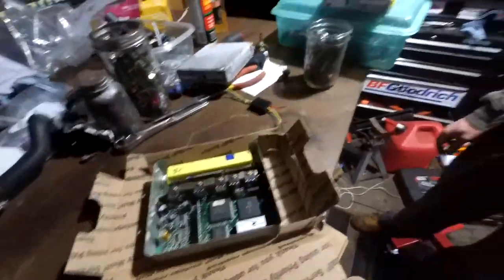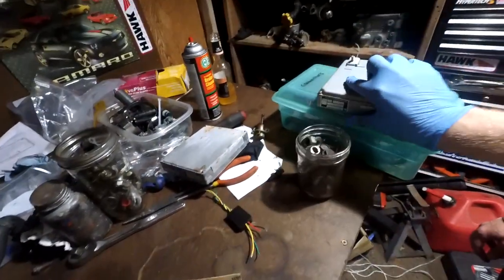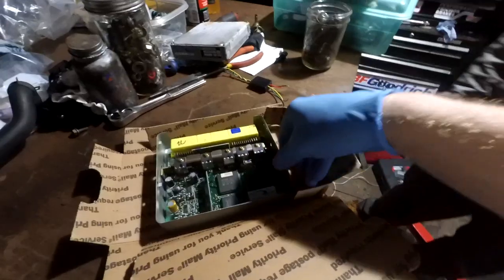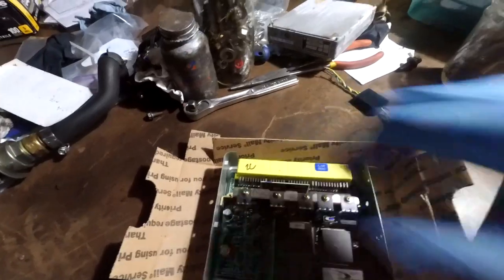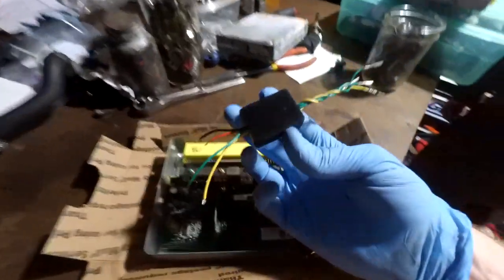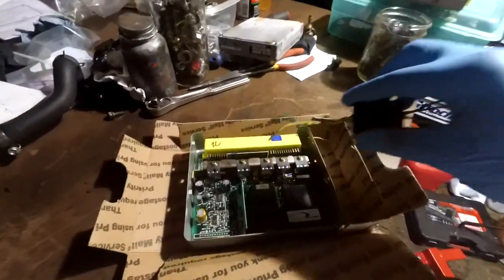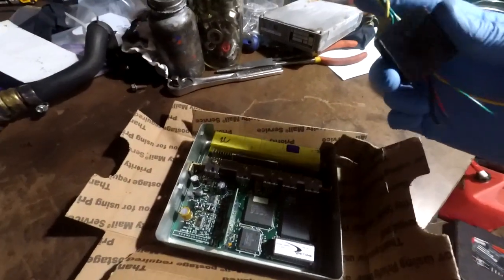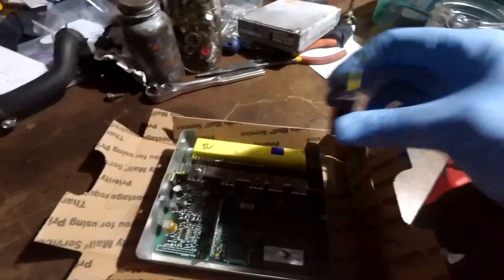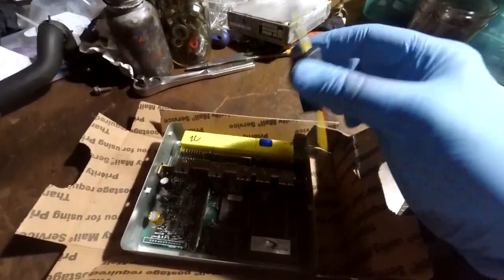Alright, so we're gonna mess with the ECU a little bit. This is my old ECU right here. We just pulled it out. I'm gonna need the housing part of it, because this is how the Robtune is when you get it. It's just sitting here in a case, and so you need to use your other case to put it together. And this is the other piece you need, which is the 4-to-2 ignition converter. So this is a 20G ECU, so it uses individual coil plug style, so it has 4 ignition wires, 1 for each coil, and basically this converts that down into 2 that a US Legacy takes, which are these 2, and then it has a power and ground. That's really all it does.